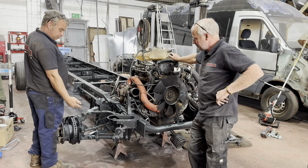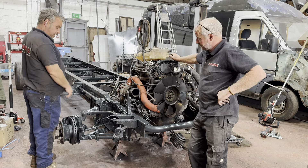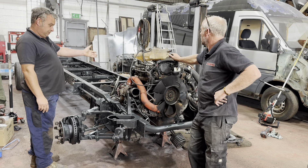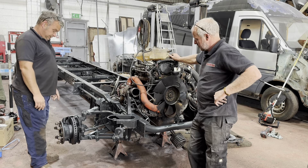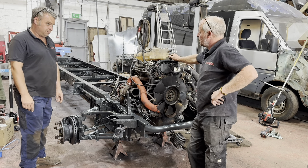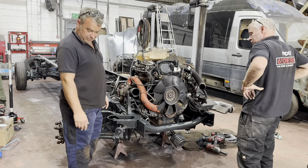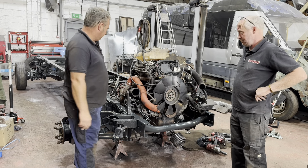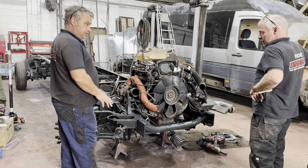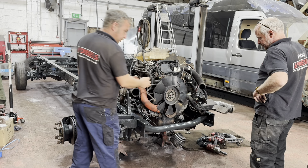New anti-roll bar bushes and the bolts that hold them all together because they were looking a bit sick. We've chiseled all the rust off front to back, torsion bar is fitted. I'm going for the last hub chuck on that side this morning, then I can put it on its wheels. I've cleaned and painted all the front including the radiator mounting brackets, and I want to pick this up with some wheels on, scoot it out and steam the last of the gunk off the bottom of the sump.